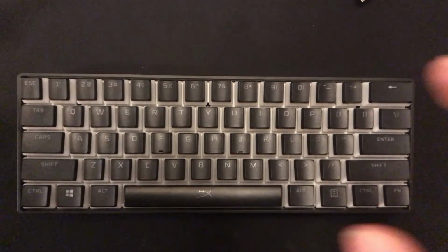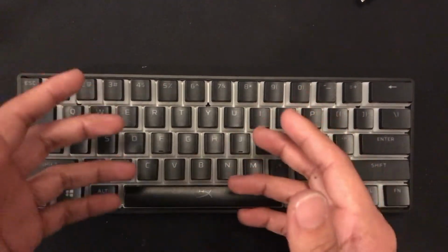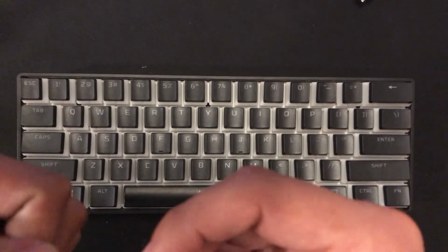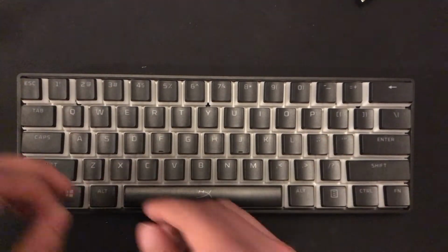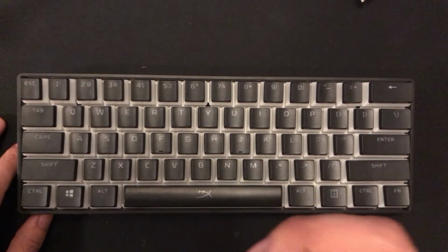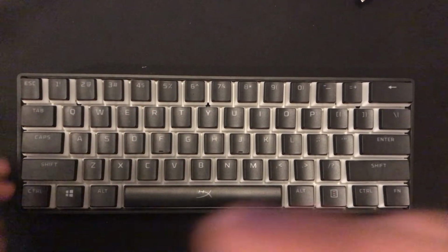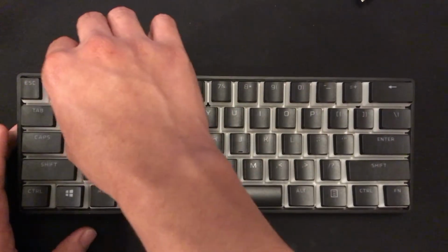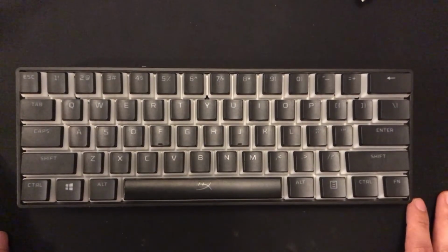You have to be patient when it comes to replacing keycaps. Because if you're not, and you hurry up like I did, a few things are gonna happen. And two things happened to me that are not that big of a deal, but for you, just to give you a heads up. The first thing that happened to me was that as I was replacing the keycaps, I noticed that I misplaced some of them. So what did I do? I took the stock key switch puller and I tried to replace it. The problem with it was that it scratched it big time to the point where it couldn't be used. So instead, I just went with the hand. Get a wired keycap puller. Do not use the stock plastic ones, because then you're gonna end up with a bit of a predicament.